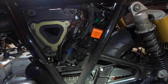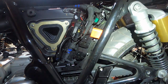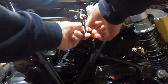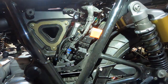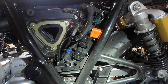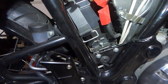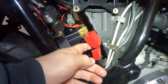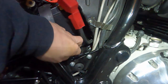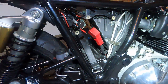I removed the right side and I'm over on the left side now. The next step is to remove the battery. On the left side I'm going to disconnect this thing right here, then take off the connections off the terminals — I'll do this side first and then slide the battery out. I went ahead and unbolted both battery terminals, pulled down the strap and pulled it off. Next step is taking out this little bracket — that's a number 5 hex on there.